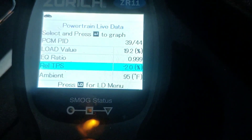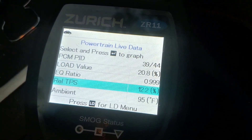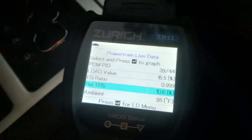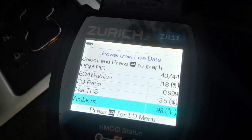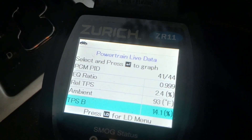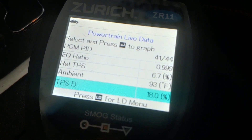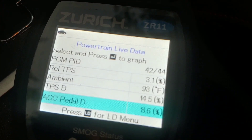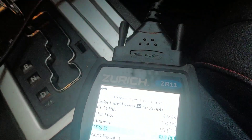I'll look into it. I do check out the throttle position sensor on this meter. As I give it fuel — see — the throttle position sensor B responds. But with my foot off the gas it just kept running, and it goes back down slowly. Maybe it's dirty. Maybe I can spray some cleaner in there. I'll try that — I'll have to get some cleaner tomorrow.